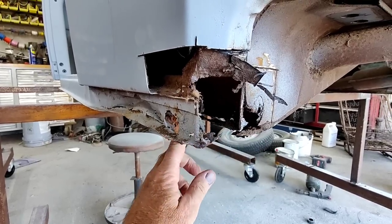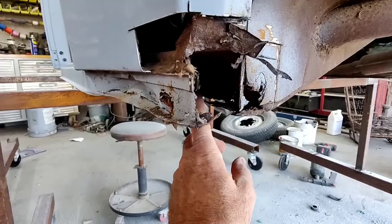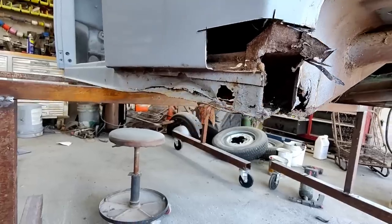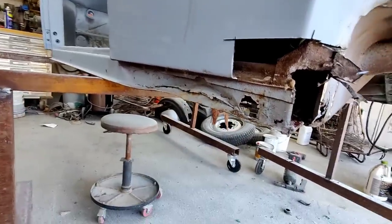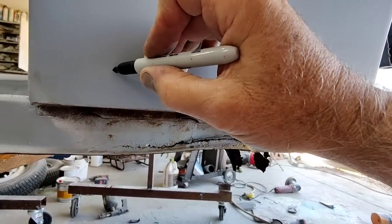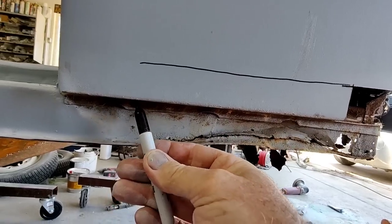I think what I'll do is probably just put a little L piece on here and fix that, the inner part of the heater channel. See how bad it is. I'm going to take off, cut right along there. Let's mark it. Just learn from the last time I had the other side. I think I'll just go across like this, right? And then I got to cut it underneath here